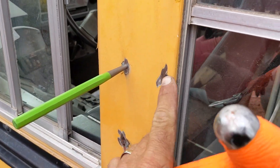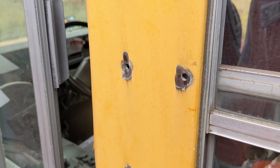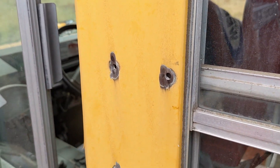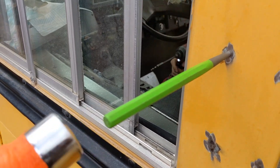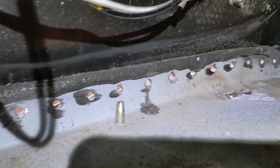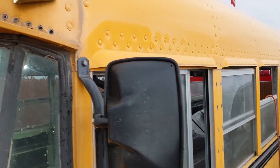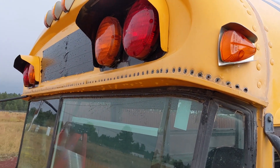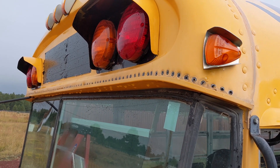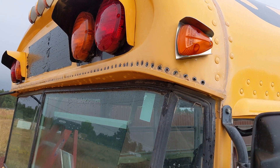When working around a window I don't use the air chisel. After I grind these off, I punch them out just gently — a little tap, tap, tap — and do it by hand. Only took a little bit of grinding and these popped out pretty well. The never-ending line of rivets is done. It actually only took about an hour once we got access to the inside. That's how you take out the solid buck rivets.